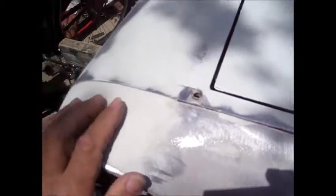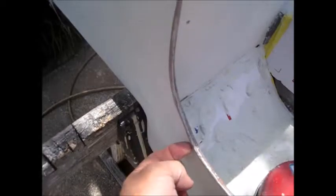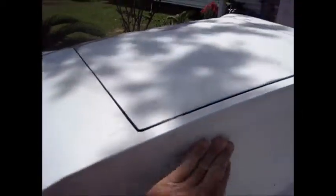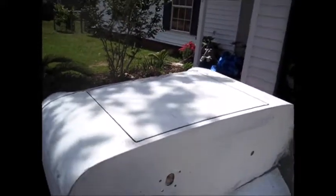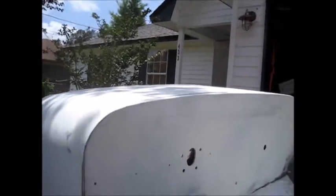I've been wiping both panels at once like this. So this part here was never up to the level as this — even though there's a bevel on the edge, it was just never fluid straight. And now it is. Can't tell it from the pictures. And also here's the little seam around this, and my dash. Got a lot of dust and body filler dust down in there. It looks really good. It will be a thin skim of glazing putty across it once I get it all basically like this. There's a little spot right there — got to wipe a little body filler there.